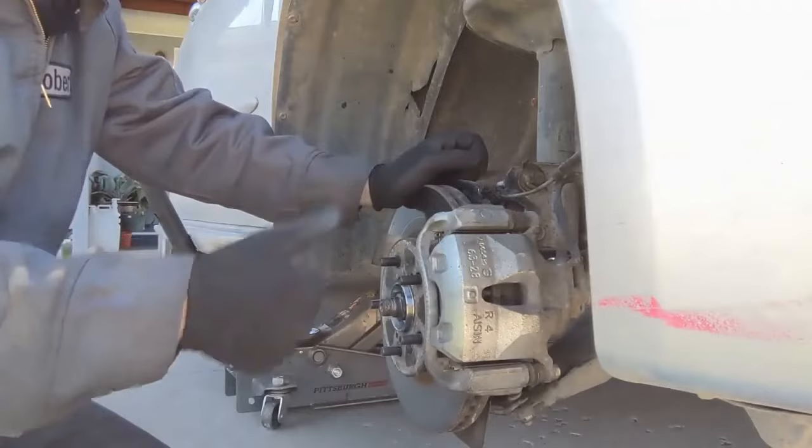That's how you can replace a press-in style wheel bearing on your Toyota Sienna — not too complicated if you have the right tools. This tool I used is designed to press in and press out wheel bearings while the knuckle is still on the vehicle; you just have to move the axle out of the way enough and then you can do it all without removing the knuckle. I took this off for ease of access and better filming so you can see the process. Thanks for watching — like and subscribe, see you on the next one.